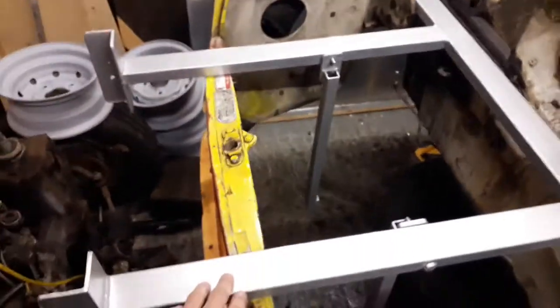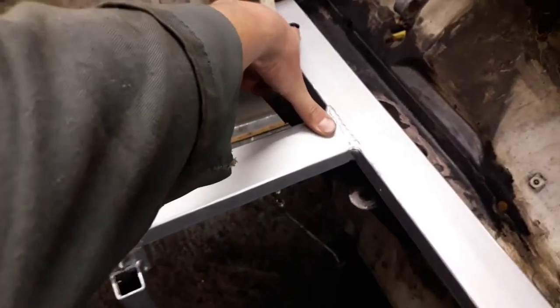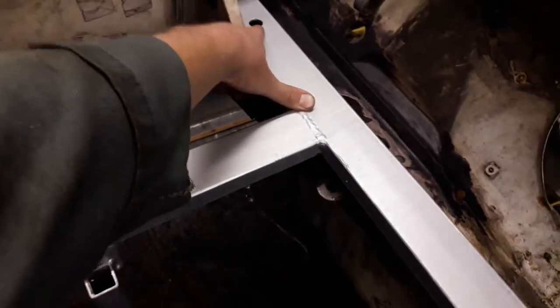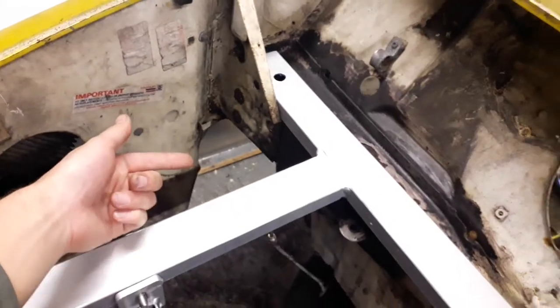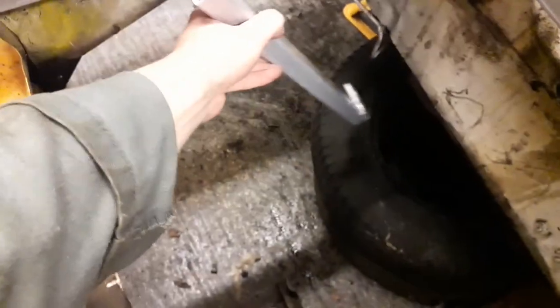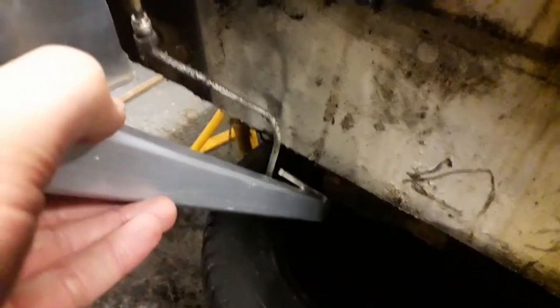This is the main front frame. What it does is you've got some big bolts which go through where the bolts for the rubber cones would go, and then there's a thick plate that goes on the underside with a nut and bolt. You've also got these supporting pieces which bolt down to where the steering rack would bolt on to.